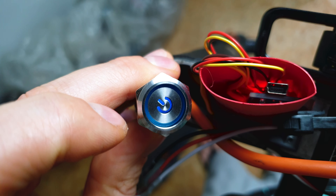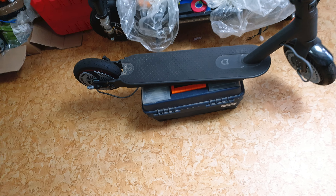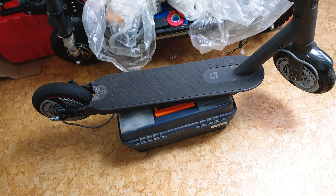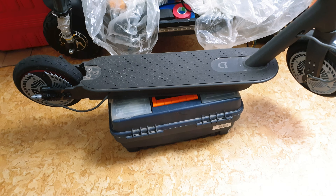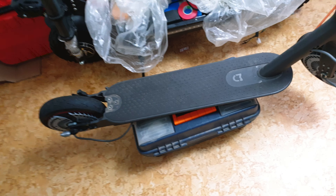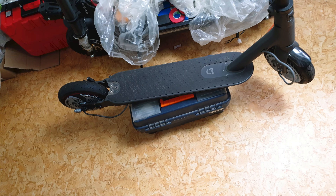Is it still working? Yes it is! Here is my old Xiaomi project — two-wheel drive with two VESCs. We've got a motor on the back and a motor on the front. Last week I had some free time, did a small test, and this thing is just mental. Xiaomi is quite small, pocket-size, super light, but thanks to two motors and VESCs it behaves more like a small Boosted or Yellow Bike T85. Every time you hit full throttle you have to hold the handlebar pretty hard otherwise the scooter will go without you. I've set 30 amps per motor in the VESC but we can also set 50 amps — just wait for next episodes.